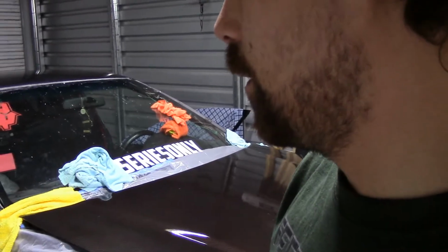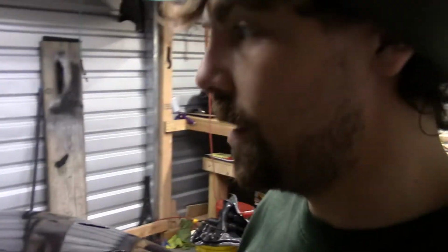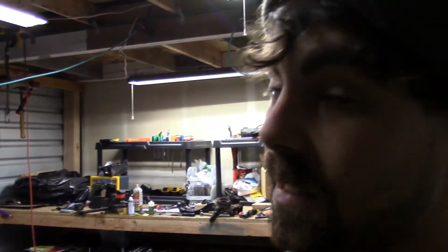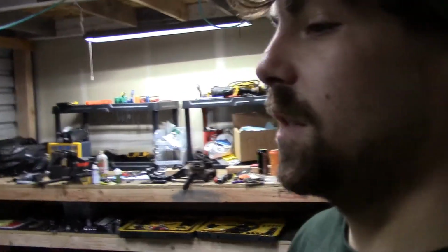I did order the lower compliance bushings last night. It was like the last thing that I actually needed to get the suspension back together, and I went ahead and went with the spherical. They call it a pillow ball, but it's a spherical style, which is ultimately going to keep the front suspension from having any kind of pull or play from the lower control arm where it would yank away from it on the rubber.